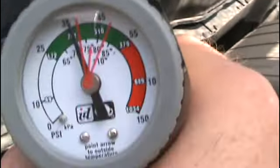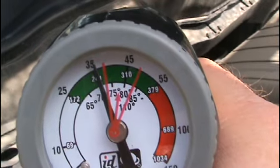Slowly getting there, and the gauge is set. The arrow is just right below 80 degrees. Because it's just right, almost at 80 right now. So maybe we'll put some more. It's just getting in that little area. So hopefully, what I've read, this might fix the air conditioning coming out of the passenger side also.